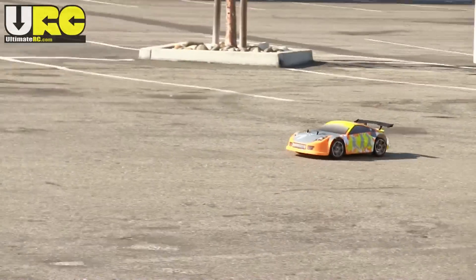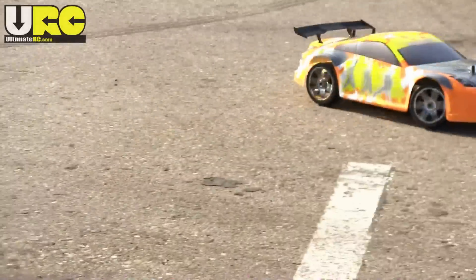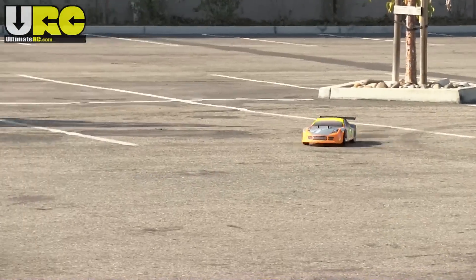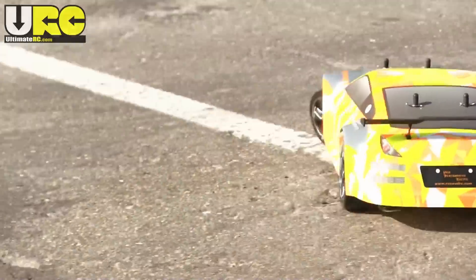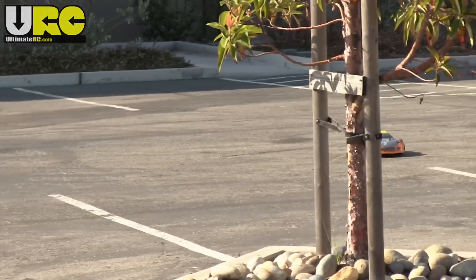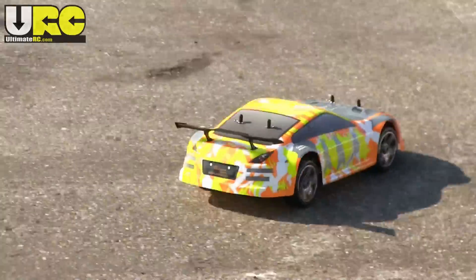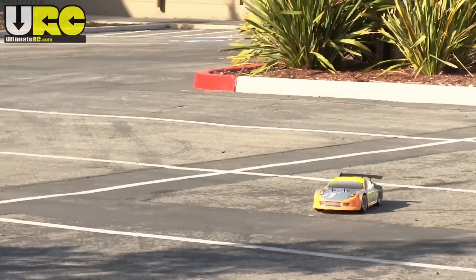The biggest thing that concerned me about this car is that the buggy it's based on is called the Mad Fire. I reviewed the Mad Fire quite some time ago and it performed really well, but its durability was poor. The fiber-reinforced plastic material they used for most of the parts was just terrible. I gave Exceed a lot of detailed and very frank feedback about that — they acknowledged it, and I never heard anything from them again. Thankfully it looks like my feedback did not fall on deaf ears. Though all these parts are still using the same molds, the plastic compound is different — it's much softer now and, most importantly, much tougher. The weakest thing on this car now is the body. It's actually made of PVC, not Lexan. If you put grip tires on it and start crashing into hard objects, the body will start to crack. I recommend shoring up both the front and rear ends with shoe goo and drywall tape — you can find a whole video about that process on my channel.